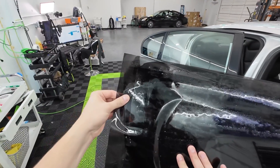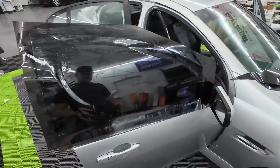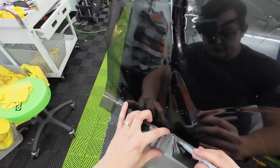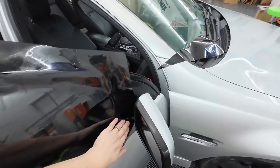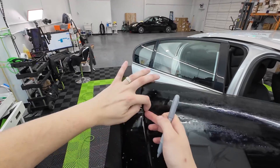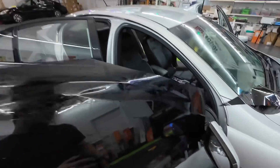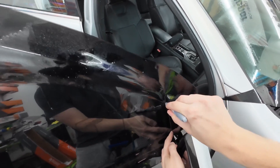Just get a little bit more thorough with it — and you can still see that slide there. It's still sliding, so be very conscious about that when you're doing this. The rules still apply. The only difference on this one is because we used a 40 or 36 inch roll, split it in half — I don't have a factory bottom edge. So we're also going to be making one additional cut down here, but we can still do that with the snitty cutter. So I'm going to mark my sides and mark my bottom edge, that way I have all the information I need to know where to make my cuts.